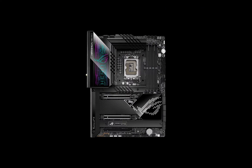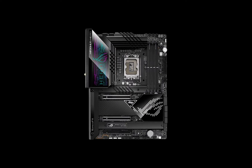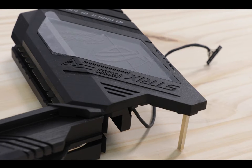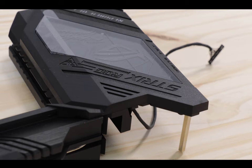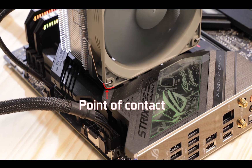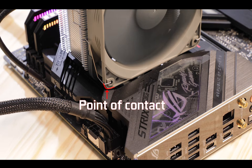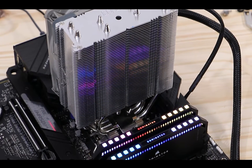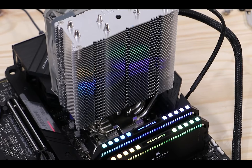One aspect which will severely challenge the more expensive Maximus 14 Hero, but something we will talk about when I review that board. On the downside, higher profile VRM blocks mean less space for CPU coolers, and as Z690 motherboards go, a lot of otherwise compatible CPU coolers won't fit your new board — yet another cost to add to the list if you really want to upgrade towards a Z690-powered build.